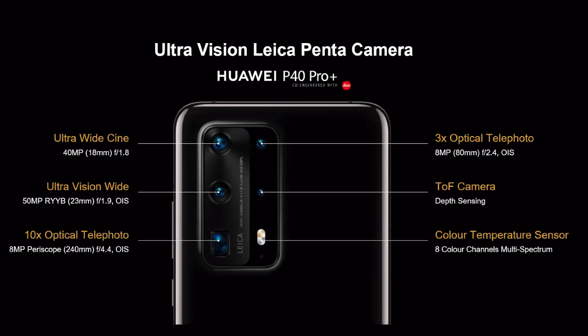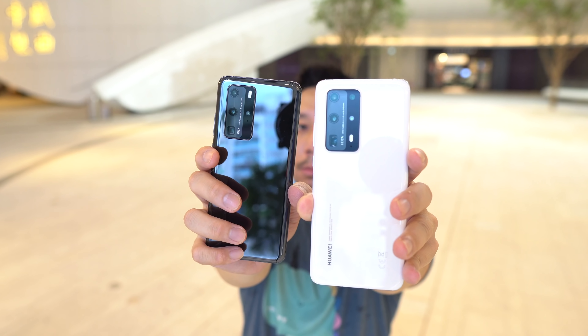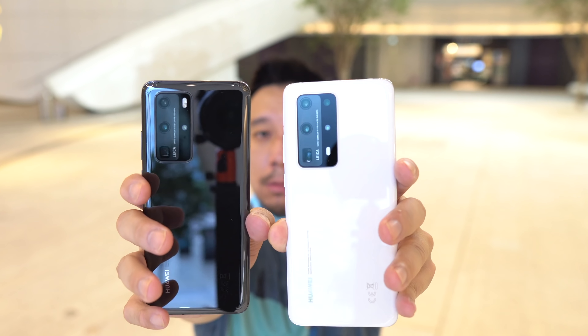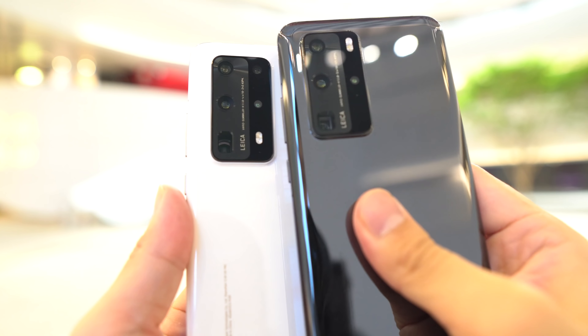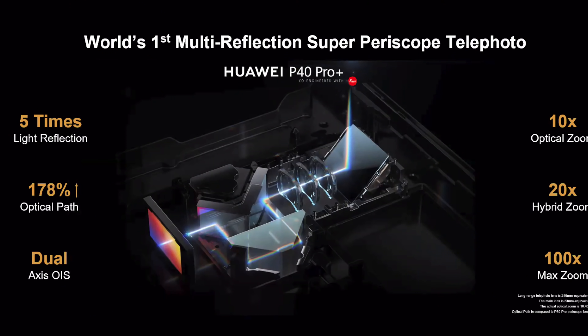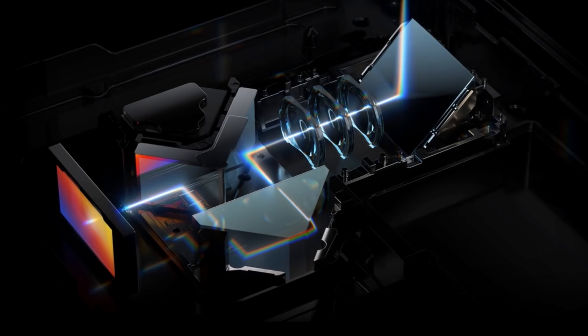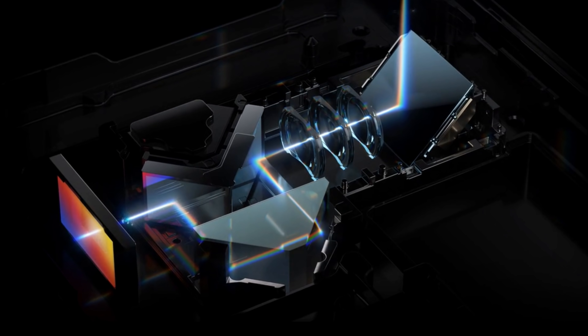It's a 3x portrait lens that shoots an equivalent of 80 millimeters. On top of that, the periscope zoom lens is also physically larger than the one on the P40 Pro. That's because this is a more complicated periscope zoom lens with optical image stabilization inside and also more layers of magnifying glasses. That technology is basically an L-shaped lens sideways in the phone, allowing image information to enter and travel through a series of magnifying glasses before it hits the image signal processor — the brain.